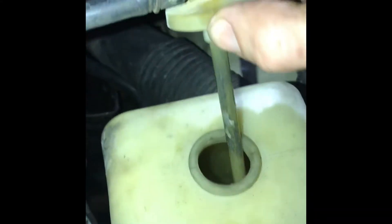The coolant system appeared to be pressurized. I re-torqued the head bolts and it held a little better, but then at RPM it would pressurize the overflow. So I re-torqued with washers under the head bolts and that fixed it a little bit, but then after a Houston trip — about two hours at 65 miles an hour round trip — it started pressurizing again at idle.